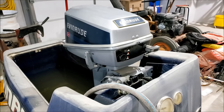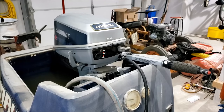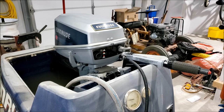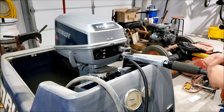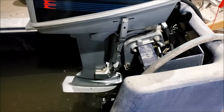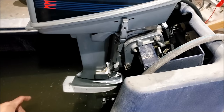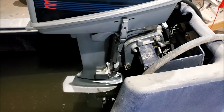Let's go put this thing in some water. This era of outboard isn't made to be run on muffs — it needs to be run in the water. I have a small tank of water here filling up that I'll be running it in. Let's go ahead and hook up the gas. It won't run the way it is right now — can you guess why, dear viewer? Correct! No safety lanyard. You'd be surprised how many people ask me why their outboard won't start. 'Do you have the safety lanyard on?' 'Uh, the what?' Now we're good — now it should fire. Don't judge me on the cleanliness of the water — it's actually the tank that was very dirty. We are almost to full. Ideally we get the water right about to where the water pump is, so another couple inches and we'll be ready.